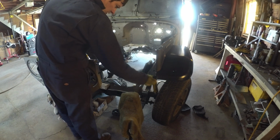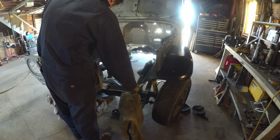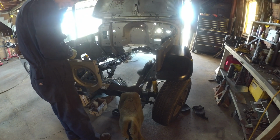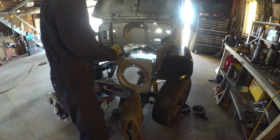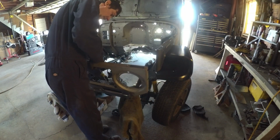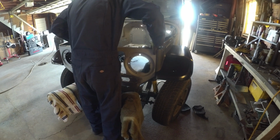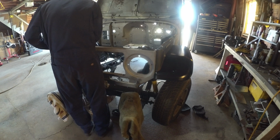These flanges seem to be off. I think I'm going to have to dolly them with the hammer and the dolly block. Luckily, they're pretty simple, but they don't seem to be quite in the right spot. We'll see when we put the bib back in, though. Never can tell. We're going to leave the bib floating. This guy is pretty terrible.